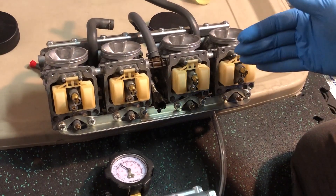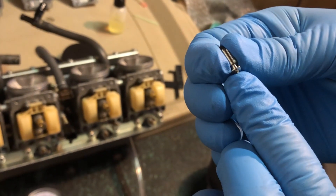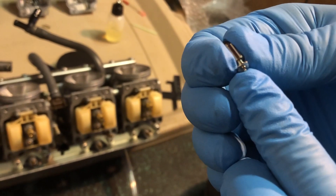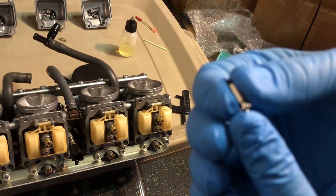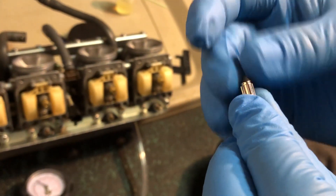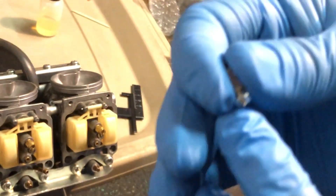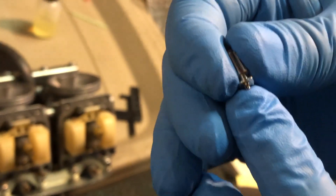What I've done is set these carburetors at an angle so that this element — you can see it's moving — is basically just a little resilient element whose function is to take care of any vibration. The idea is there's a little tang on the float that pushes against this thing, and then the needle seats and seals the float valve. When that happens, this movable element is not compressed at all.